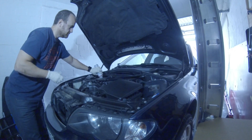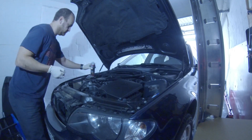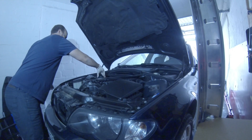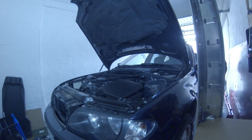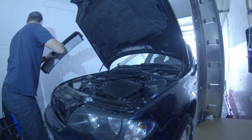That's why I am going to use one and a half cans, because the engine has a capacity of 6.5 liters. So if you are flushing a smaller engine, you can use only one can. Now time to start the engine again and keep it running for 10 minutes. As the engine is running, I will use that time to remove other parts.